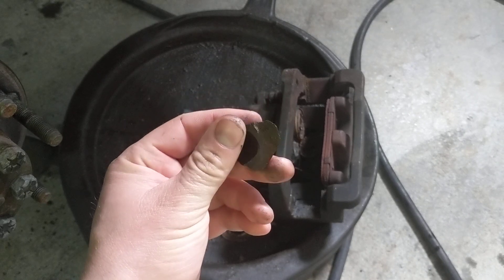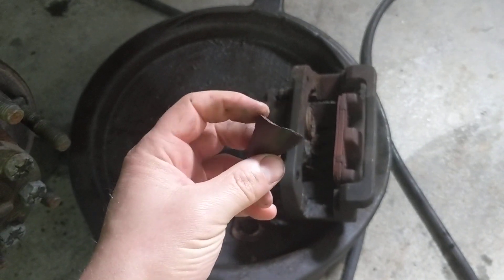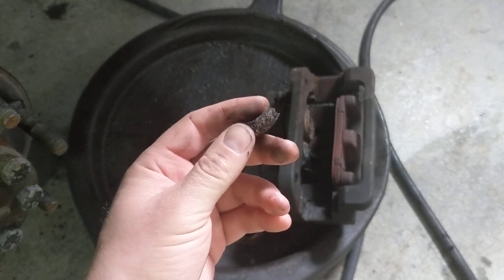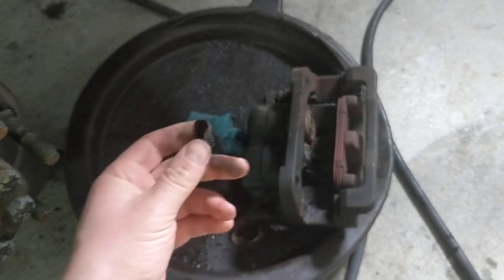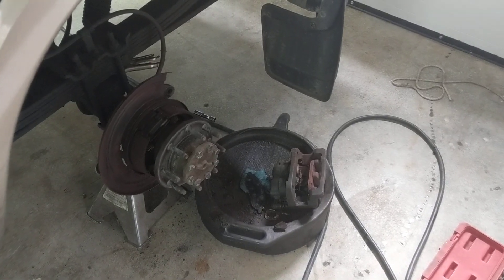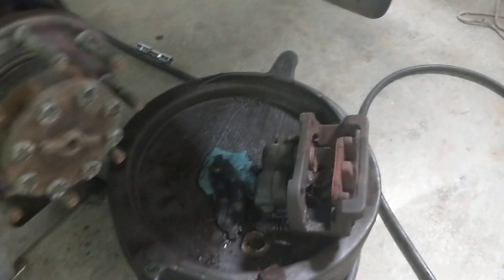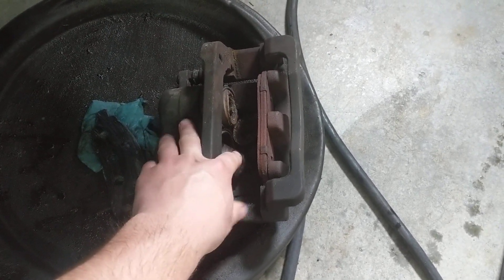On the flip side, this plastic piston is not as strong as steel. I've never had another vehicle with phenolic pistons, and I've never had as many brake problems as I have with this truck. I don't drive it often — maybe once or twice a month, and not at all in winter. My other cars with steel pistons get used similarly, and I have no issues with those. This is the second — technically the third — time these pistons have broken apart.